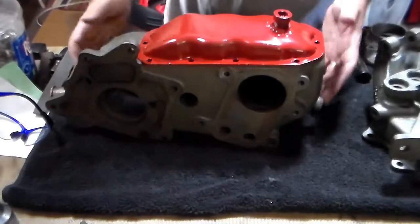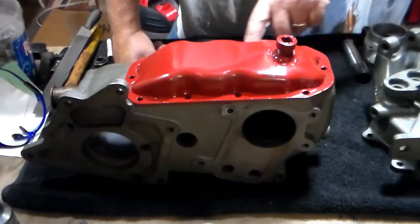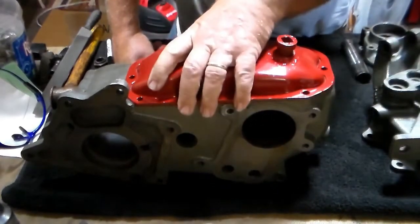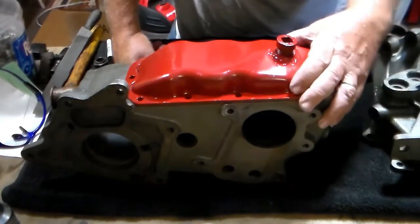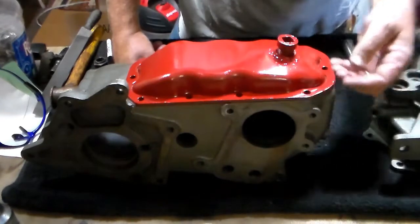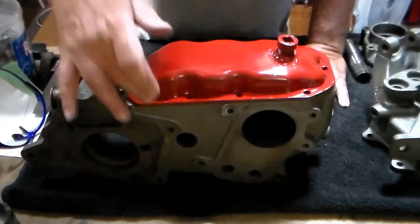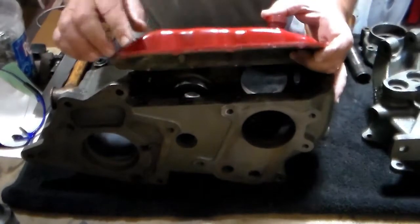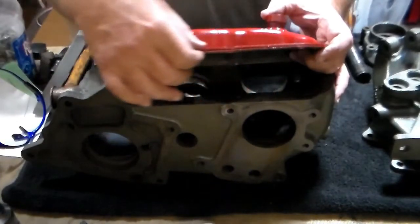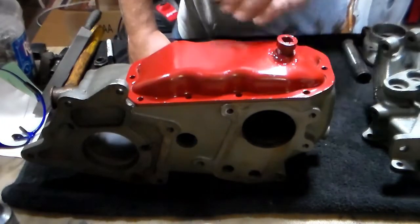The last part of your case is going to be the cap — this is your bottom pan for your transfer case. Look along the bottom edge all the way along and make sure there's no air gaps. What will happen is people will tighten and tighten these trying to seal up a leak, and in reality they just had a bad gasket. They kept tightening and they've distorted this cap, making it leak worse. This one's already been straightened and repainted. What you'll find is these will flare out and won't be nice and even along this edge. You'll have to flatten them back out on a nice hard flat surface and tap them down with a hammer until when you sit it back on and look under it, you don't see any daylight shining through.